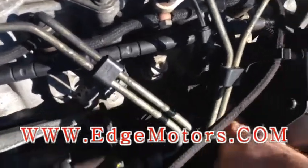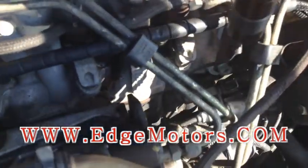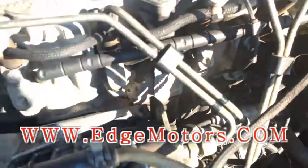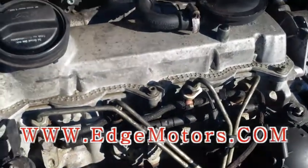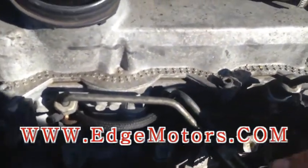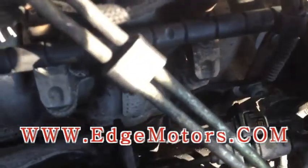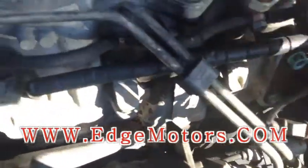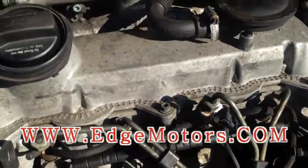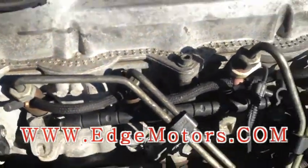What we're gonna do is take this plug off the injector — see how it's plugged on there. We're gonna pull it up so the wire from the injector lays freely and has more slack. We take the plug off the bracket — see it's loosening around, now it has a lot of slack. The plug just pops out; you don't have to disconnect it or anything, just pop it up and it comes out very easy.